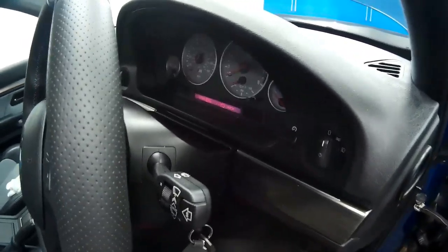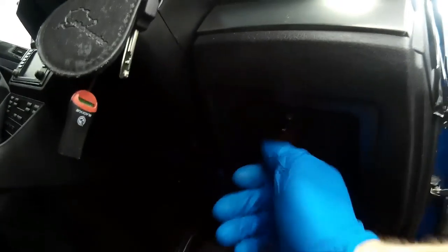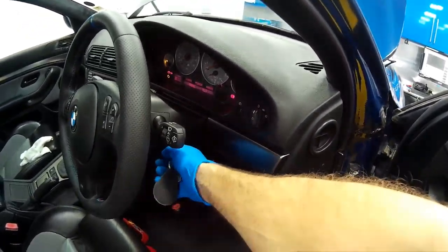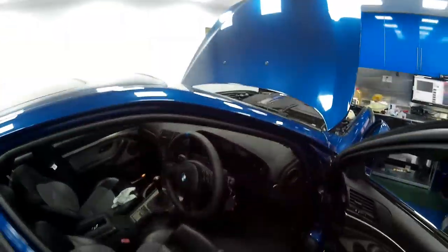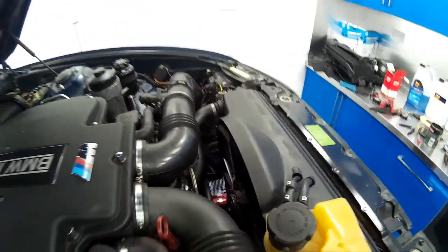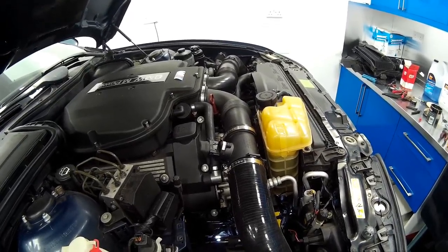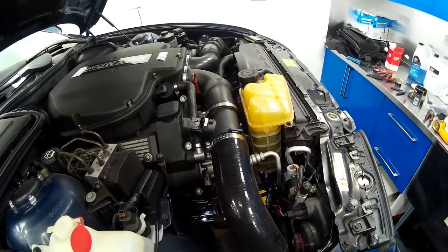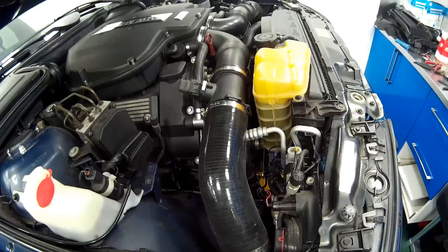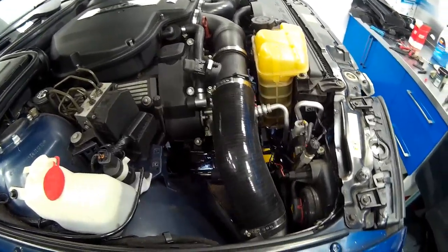Now the wires have been fitted to where I want them, time to test the fan switch system. Turn the ignition on and the fan will run — as you can hear, the fan's running. Turn the ignition off and the fan will continue to run for a further 10 seconds. That proves the electrical fan system is working properly. Also proved yesterday that the temperature switch side of it is working properly — when I bled the coolant system I allowed the fan to operate before turning the engine off. Unfortunately I didn't manage to get that on video because the battery died, but it's the same principle as what I've just done except automatic.